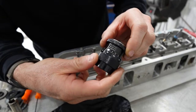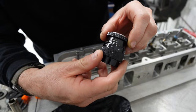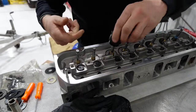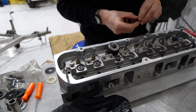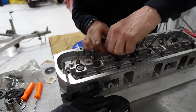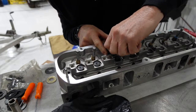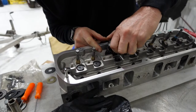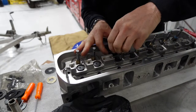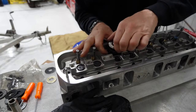This goes from 1.678 all the way to 2. So you can read 1.80, 1.81... We're shooting for 1.85 installed height for these springs. We put that on there, take our valve keepers and put those in, then screw this guy out and see where we're at. We're looking like almost 2 - that's 1.883. We need... so that means it's too tall. We need to make the shim stack taller to make the installed height shorter.